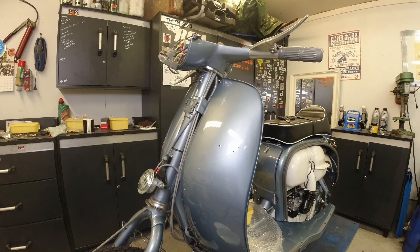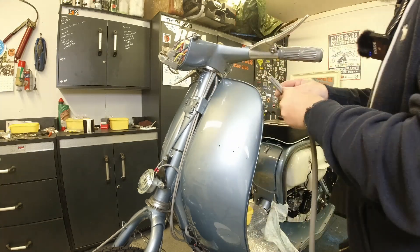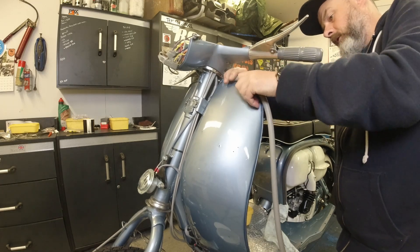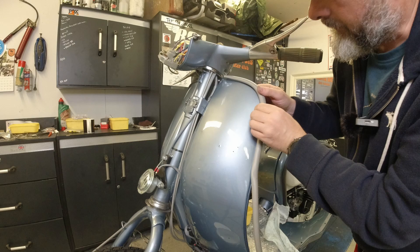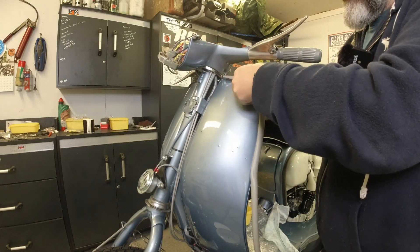Because the end cap on the top of the rubber on the leg shield is hidden by the horncast, I'm going to fit the leg shield side rubbers first. You can see there's a V profile here — this V actually hooks up underneath the edge of the bead on the leg shield. I'll dry it off and just hook it open — normally not a hard job, but I can make it look hard! I'll feed it around the edge and hook it in. I'm popping the V bit into the V groove on the leg shield, and I can feel it clicking in — there you go.